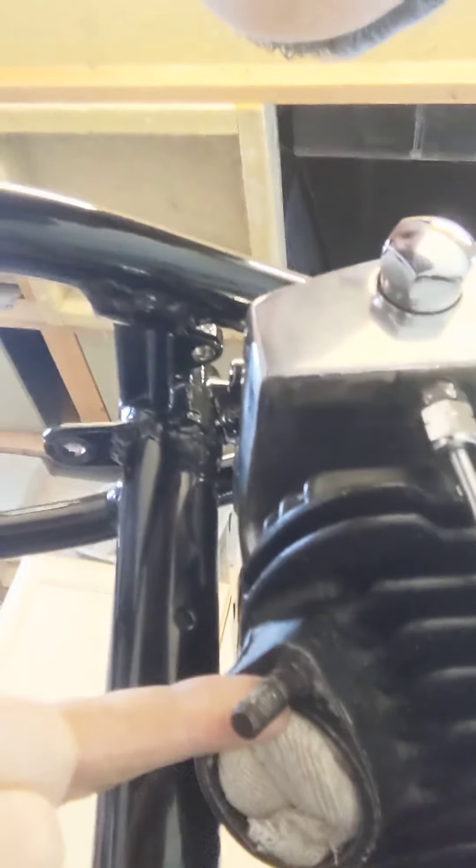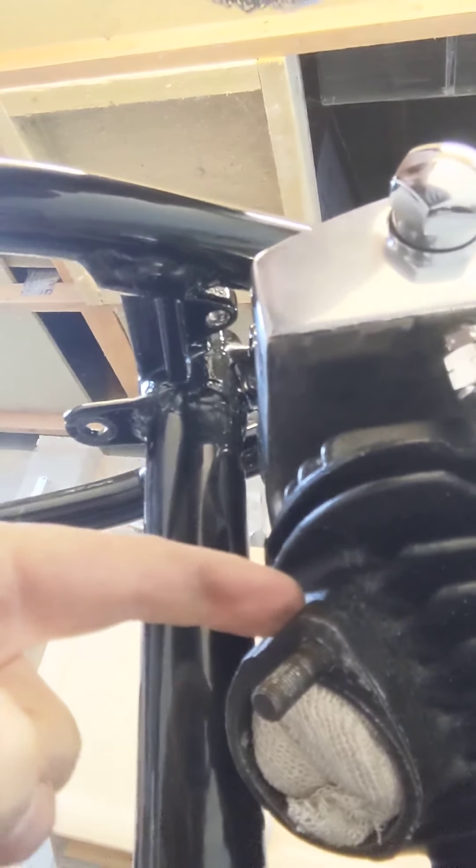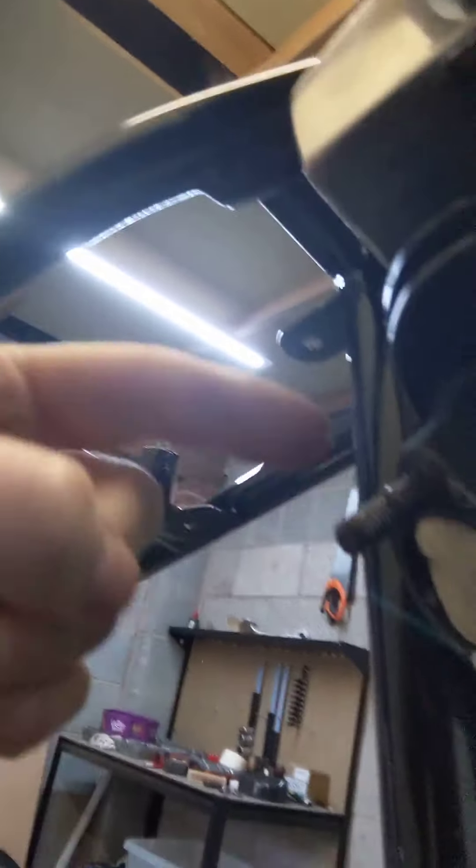So I've got that in already and then I've put the down tube in. The exhaust previously just had - I think this is what they have as stock - just a stud in there. I think it's UNC into the engine and then you have a little UNF bolt that's chewed because I've had pliers on it trying to loosen it off, but I left it in there to show you. That's what you used to have.